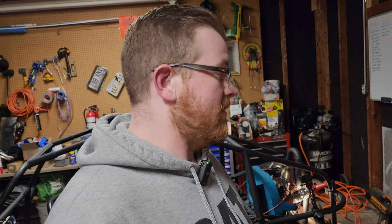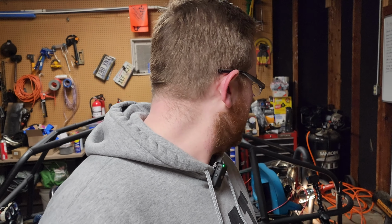We got the carburetor rebuild taken care of. Haven't got any of the settings put together yet, but before we get it fired up, I think I'm gonna do a couple last items. I want to pull the valve covers off and just see how those valves look as far as their adjustment. It was done last year, but I'm just not sure if it's stuck. I want to make sure those aren't off. I'm gonna set some of the settings up on the carburetor, put everything back together, and turn the fuel on and start this thing up, see how it runs. So that's the next step.